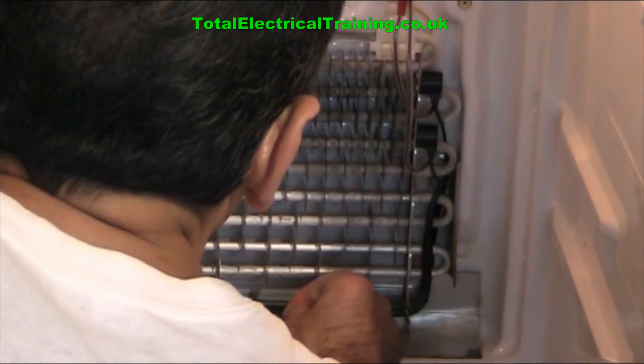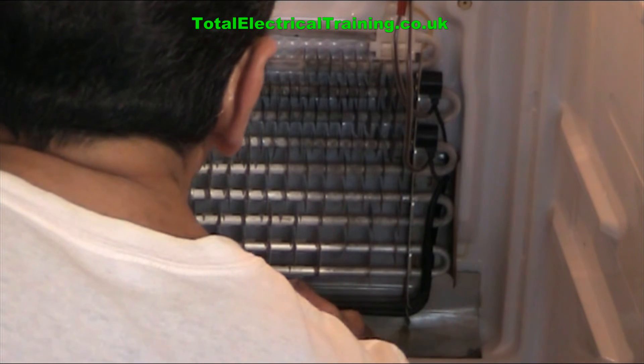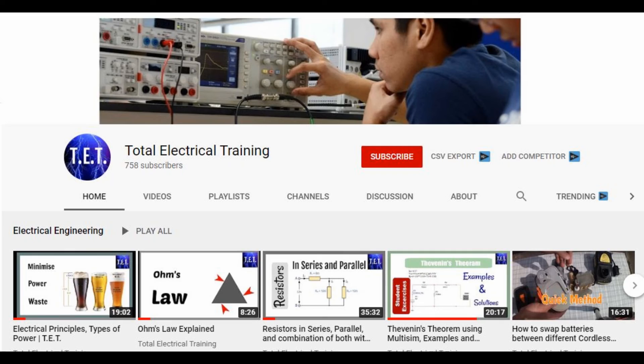The ice is all melted now — just make sure the drain hole is open. The heating element appears to be working because the evaporator is getting frosty but not all the way down, maintaining the right temperature. So I can put the cover back on now, and I've shown how to do that in the other video which will appear at the end screen. Hope you enjoyed this video — if you did please share it to help other people with the same problem. Until next video, goodbye.